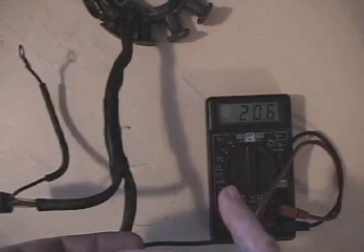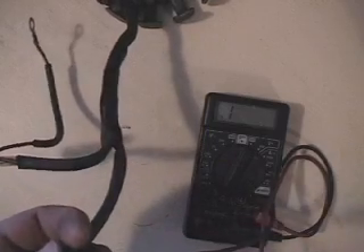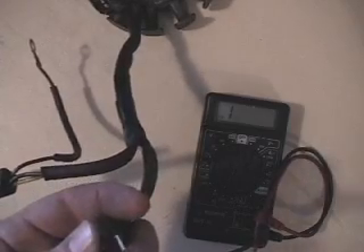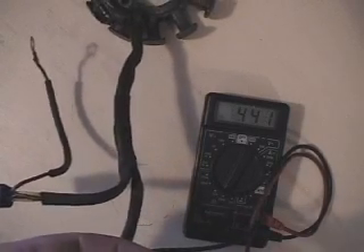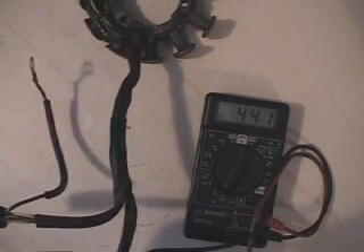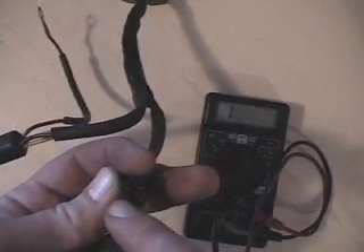It rounds up because the multimeter was on a higher setting, but it's 20.6 ohms. I put it back down to 200 so it's a little more accurate at a lower ohm reading. Now I bump it back up to 2,000 because we're going to look for 450 ohms for the primary or the low-speed coil. That one is measured using the top two connectors — top left to top right. On this particular stator we've got 441. This is just one I had sent in as a core, so we've got 441. The bottom left of the plug is just the ground — you don't use that to check anything.